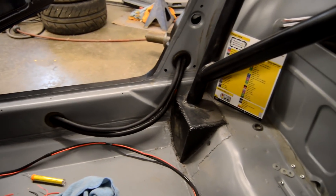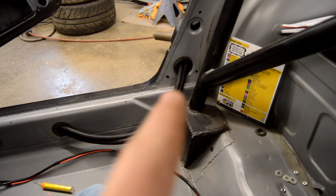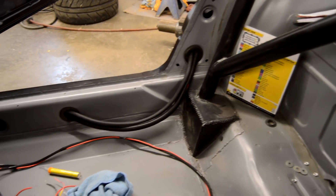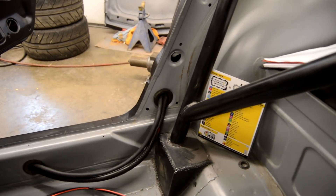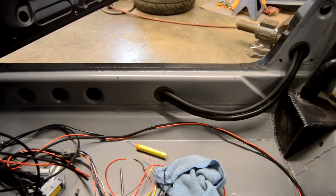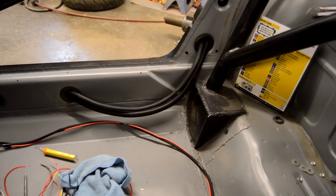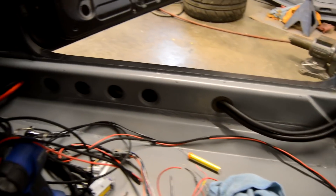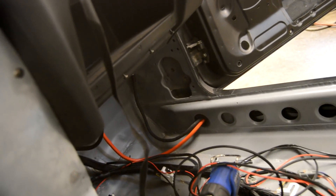This is where I had issues — I hadn't replaced the rockers on this car so I didn't know, but there's actually a block-off plate behind there that I probably would have had to drill holes through to continue with fully hidden battery cables. For ease, I ran it through that hole there and back into the first hole in the inner rocker — that's both the ground and the power cable. The power cable has wire loom around it pretty much the full length of the car. It runs through the rocker a little bit and then comes out that first hole, and then the ground goes up and bolts under the dash.